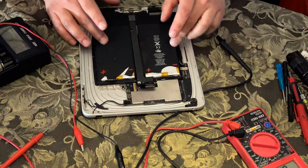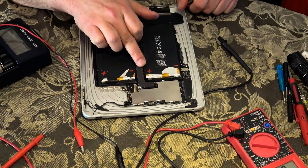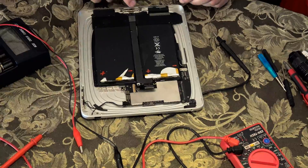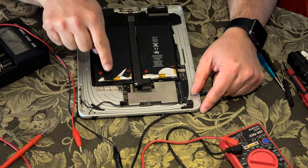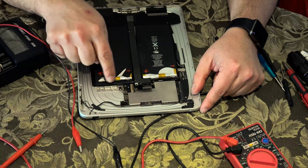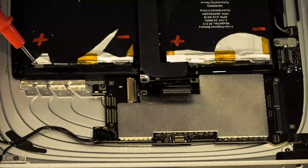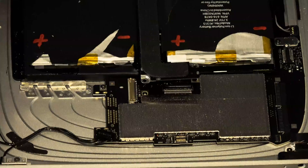I had started originally intending to remove the whole battery before I realized I only had to peel off some tape, so disregard that disconnected piece — just pretend it's still connected. There's a thick black insulating tape covering the battery packs. If you very carefully — and do not use any metal tools — peel back the tape towards the top of the iPad, you can see the strips right there. Peel the tape off and you'll see bare direct battery cable terminals exposed.